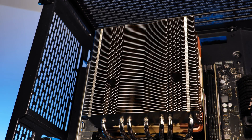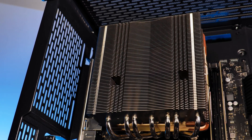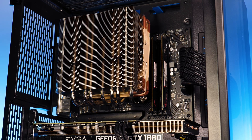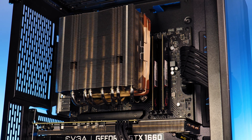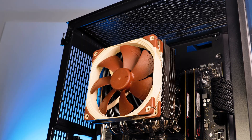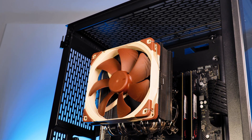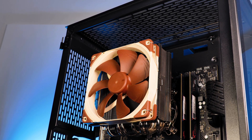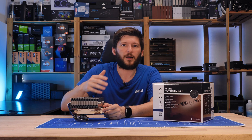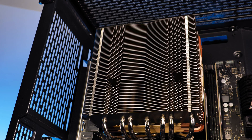An excellent result, considering how low-profile this truly is. Where does this leave us? Ignoring the design — which is the usual thing you have to decide for yourself — the C14S is clearly a highly optimized cooler, but highly optimized for a specific purpose. It is still a low-profile cooler, or at least aimed to be used as one. Whether you go with 142mm height with the fan on top or 115mm with the fan underneath, this cooler is not made for the standard box-like PC case — the potential RAM restriction is the best example of that. In my opinion, this should not be treated like an average CPU cooler; it is your average low-profile cooler. And that's really fine, because in that size category, the C14S is a master. If you're doing some sort of weird semi-SFF or compact build with impressive cooling and can spare 150mm of height, the C14S is definitely one of your best options.